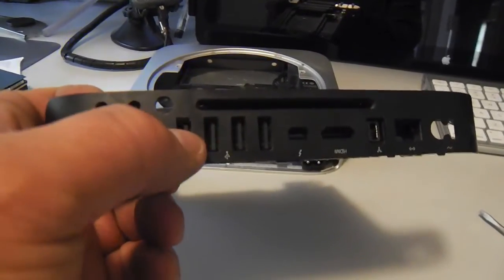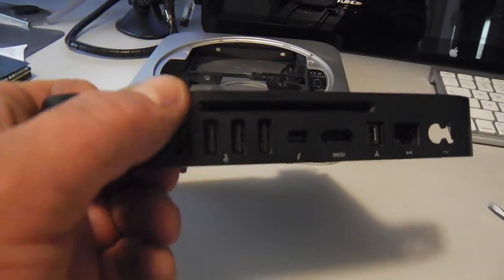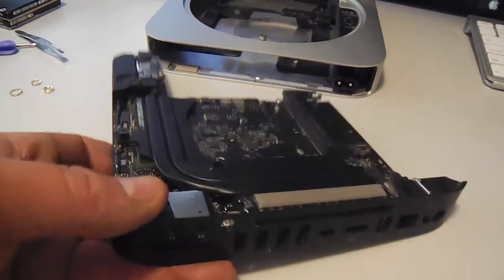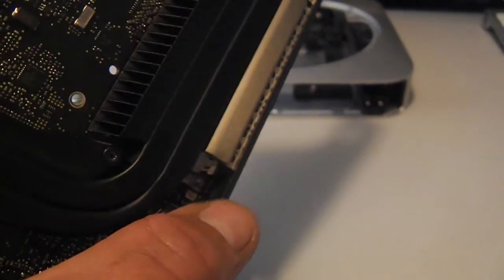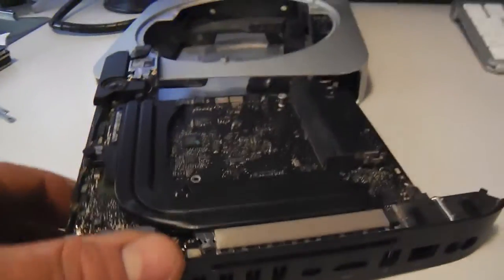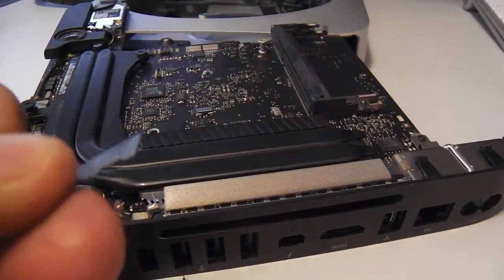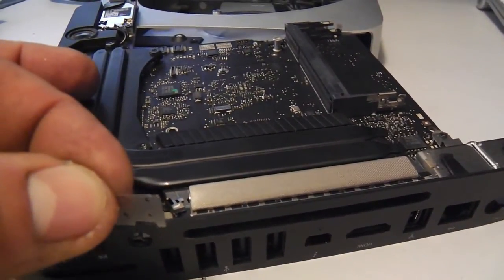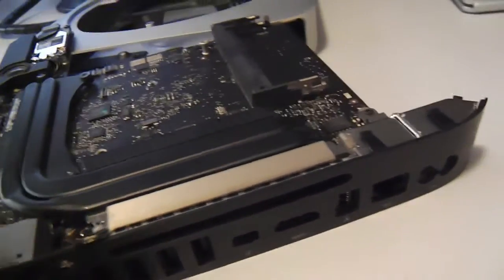I bet I can place the most slender USB cable in there and it'll go along with whatever the antenna looks like. But when you go behind here, you'll see some metal — it's shielding. I remove that; I don't recommend that you try to drill through it. This is what a piece of it looks like — this is metal shielding. It's behind here. If you drill through there, it's going to resist you. I just pluck this one piece off, but there's actually another layer of it.